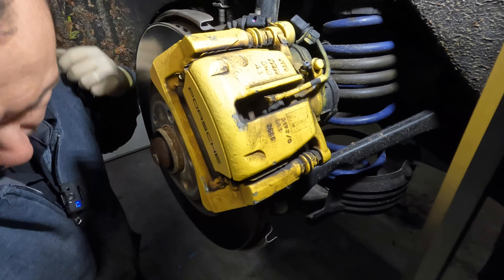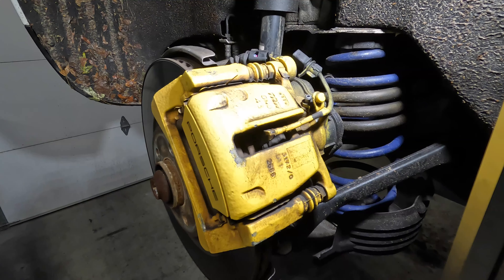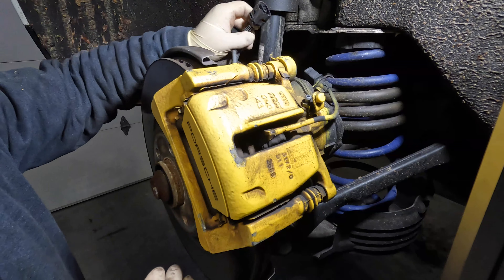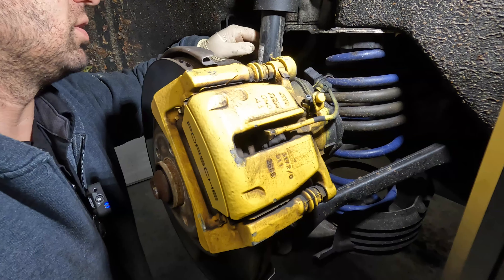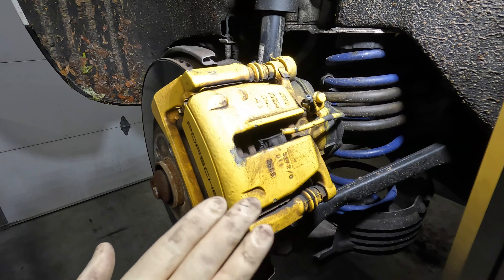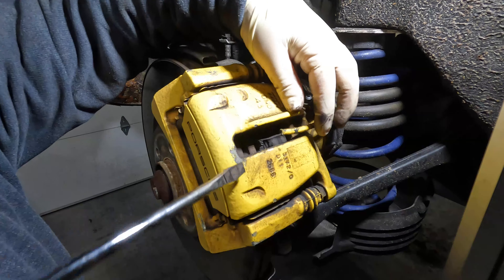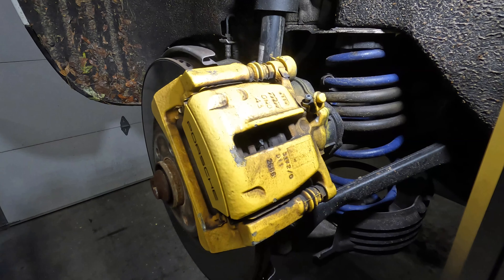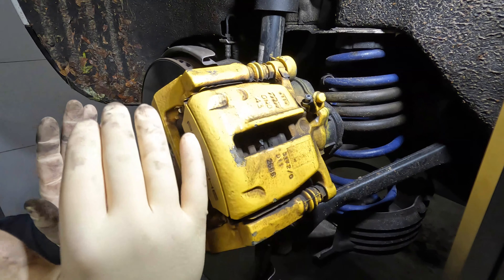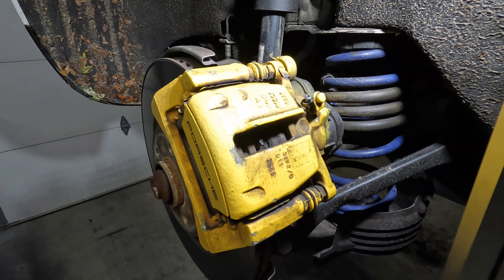The reason I disconnect the motor connector is not because you have to — it's just that it gives you a little bit more clearance when you remove the caliper itself to swing it over. I'm going to put my connections behind the shock here. Now that we have everything disconnected, what I'm going to do is go ahead and remove my brake pad wear sensor completely. You can just kind of rip on these and pull them off — I have new ones. The reason I like to remove the wire and everything first is so when I remove the caliper it will just come off and I'm not fighting that wire.